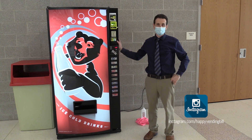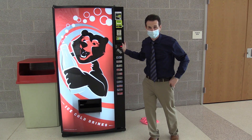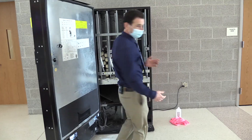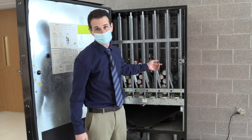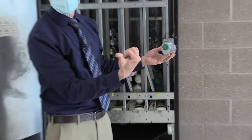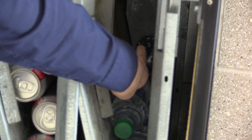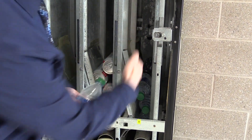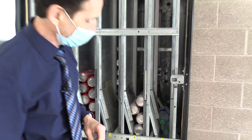If you have a soda machine like this stack machine — this is a Merlin 4 — and you're having bottle jam issues, the first thing you want to check is that you're loading the bottles properly into the machine. Most Royal machines like this have six columns in the front and then six columns in the back. When you're loading bottles, the products in the front columns, you want the cap of the bottle to go toward you. And then the bottles in the back column, the caps should aim toward the back of the machine. The reason for that is you don't want the caps of the bottle hanging up on the center part of the machine — it creates bottles that tilt like this, and that leads to jams.